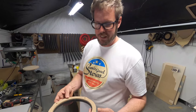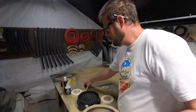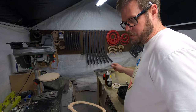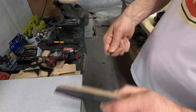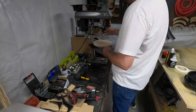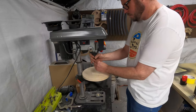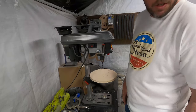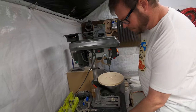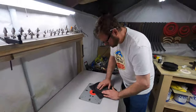You try to put it back on to align to the holes, but no, you don't want to do that. You want to put the proper drill bit we have that fits the holes perfectly. We're going to put that in our drill press. You always want to use a drill press. Doing it by hand, it won't line up again, ever. Chuck is gone. Chuck don't like to hang out. Got a funny story to tell you about Sage and Chuck.